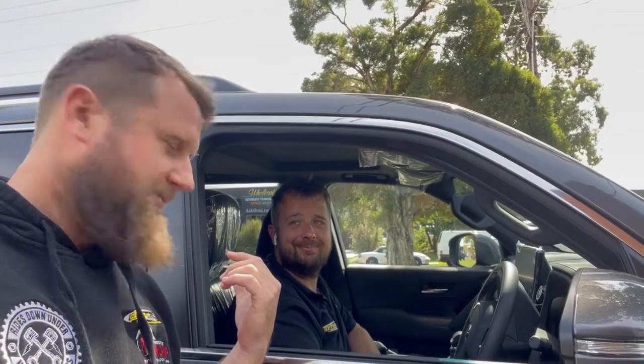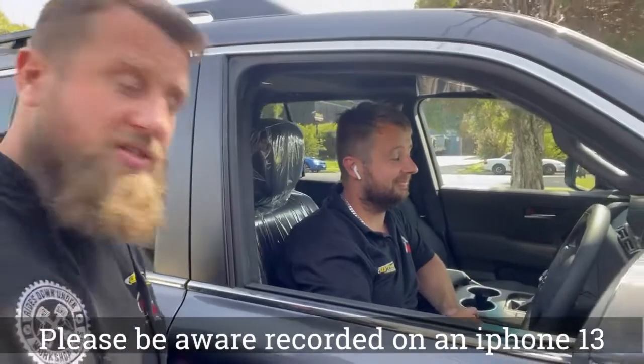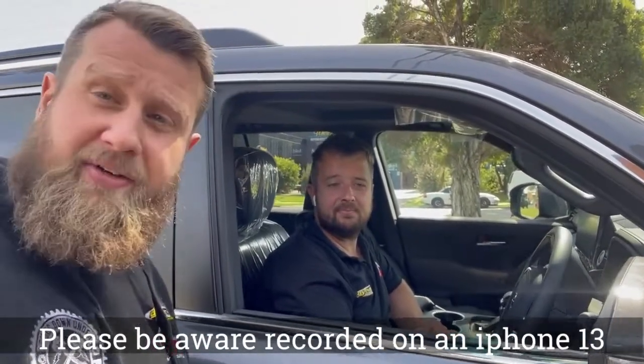What I'm going to do is get someone else in the driver's seat, I'll go to the back of the car, rev it up and have a listen, see what it sounds like. So I got Chris out here — he's going to be giving it a rev up for me. Some serious injector rattle right there. The injectors are noisier than the exhaust. Chris is going to rev it up for me, I'm going to go to the back of the car and have a listen, see if it's any louder at the back.